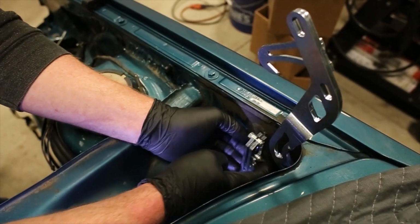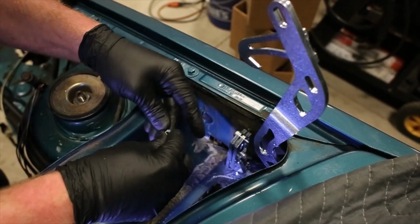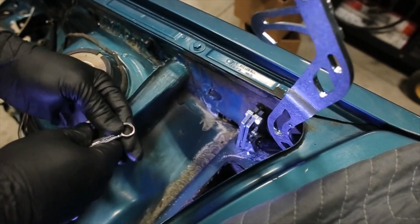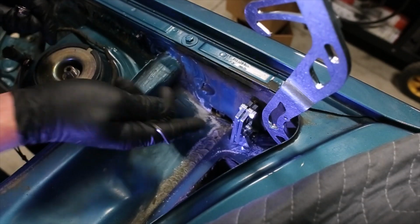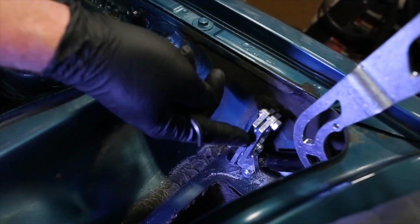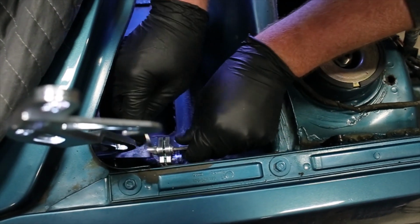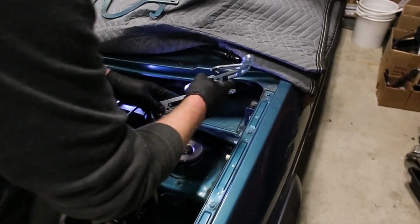So what you do is you're going to want to tighten the top and bottom bolts, but first I'm going to turn this around so the button head is actually facing forward on the car. It gives more clearance for the actual catch on the hinge. And we have found that it's easier for the nut to be facing forward just for tightening purposes. Tighten all that down. And one thing you want to make sure is that your lower shock support is in line with this hood catch that's built onto the car. And that side's installed.